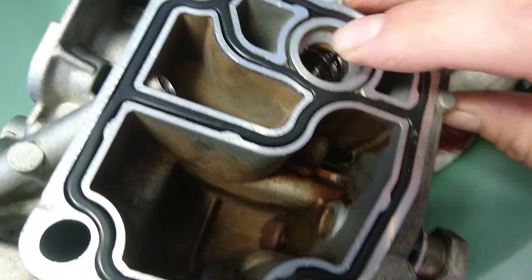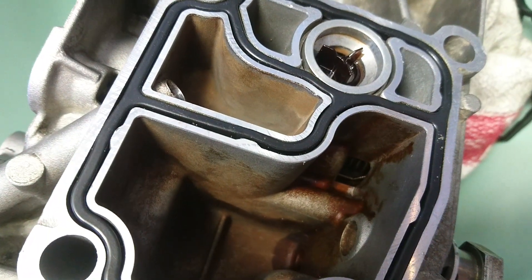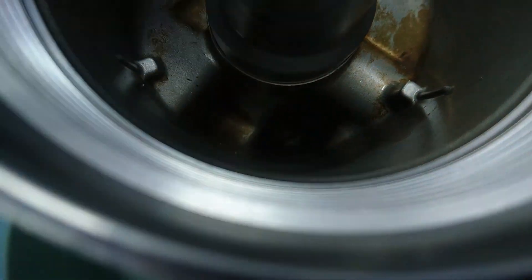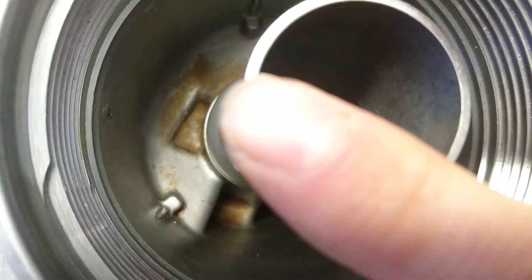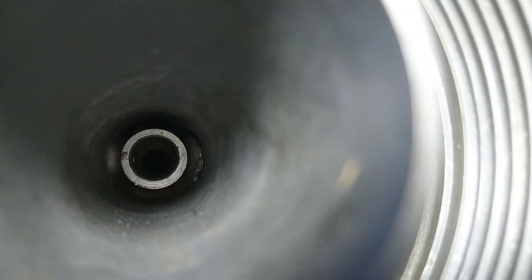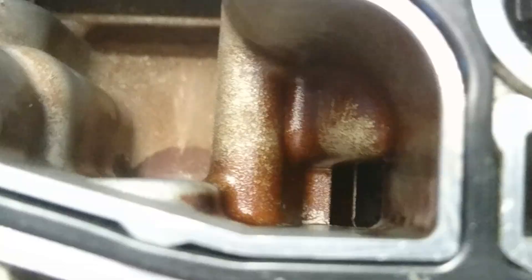This is the place where the oil from the sump, pressurized by the oil pump, will enter this assembly. When it enters, it will pass from the outside through the filter, then through the bigger inner tube. Over here — it looks like a crack but that's actually the hole — is where the filtered oil will pass through.